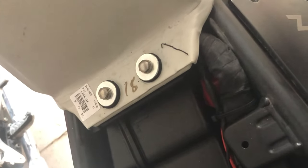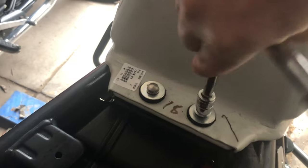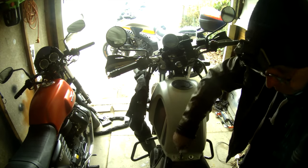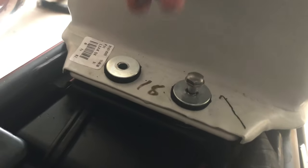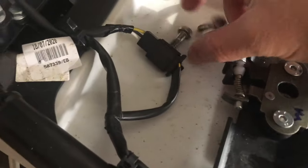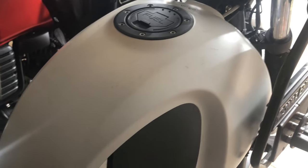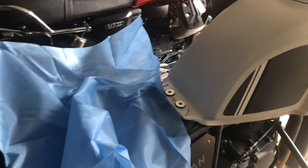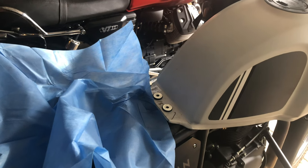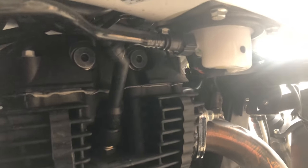I've just got to undo a couple of bolts to get the tackle. There's a handy little trough right at the back of the bike, so we'll just pop it in there. The tank is now loose — it's got a couple of retaining levers at the front, and we've got to undo the cables to the pump and also the fuel tubes. I'm moving the tank backwards off the lugs so we can unplug everything. There's the fuel pump — that's got to get disconnected.